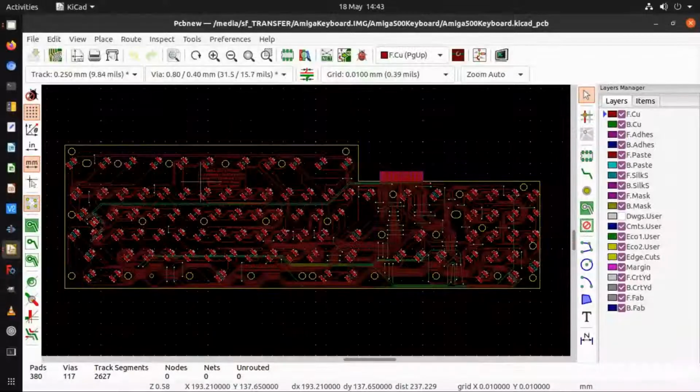There it is. And so this is actually the files which I ultimately used. There's not much to say apart from I basically traced over the image file like you saw previously, and also the actual holes to punch out. So there's these yellow holes in the actual PCB which go around the screws which go through the PCB. So you need those holes in the right place.